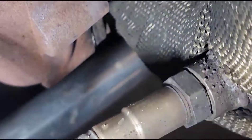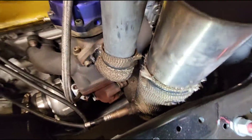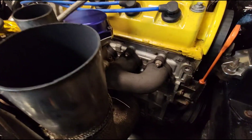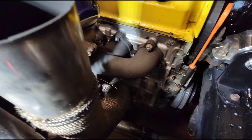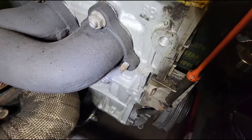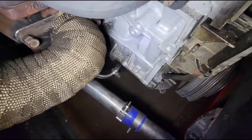That exhaust leak is before the O2 sensor, and it's going to throw my air-fuel readings off. How bad? I don't know. Is it good? Not at all. To relate it to something people might know — you can train for a marathon, but if you're smoking two cigarettes a day, it's not a good thing. Should you be doing it? No. Also, there's a nut missing on the manifold. This is all basic stuff — it ain't rocket science. You can't have an exhaust leak; this is fairly common stuff.